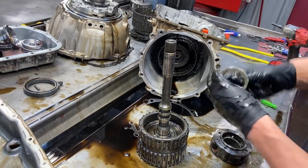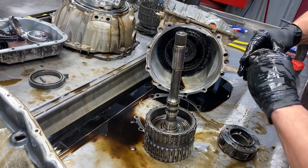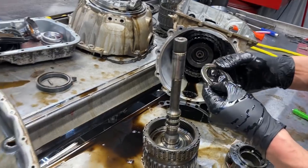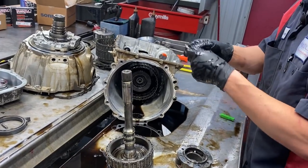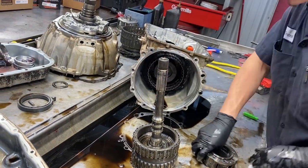Four tab washer - we're replacing that as well. Bearings - we've got big bearings in this thing but it's always good to go back and check all this stuff out. You can take some of these apart, just be careful because you can ruin the bearing. Double check everything. Right now this bearing sounds bad, but I'll clean it up and get all the metal out of it and it could be good. Set that to the side.